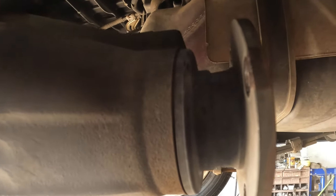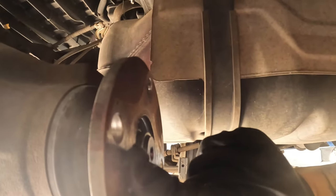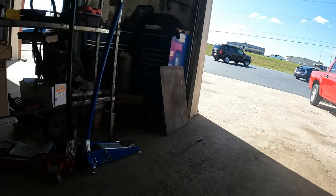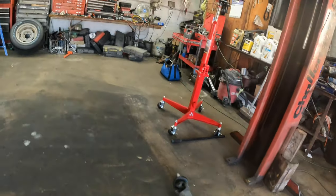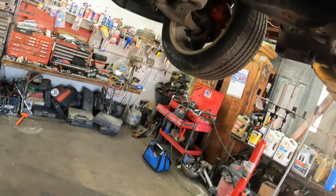I did color the differential and the drive shaft with some orange paint marker — it didn't show up too well on the differential, but I can see it. I did that because I want to put it back in the same spot just to eliminate any vibration if there happened to be any. We're going to pull the slave cylinder off next.